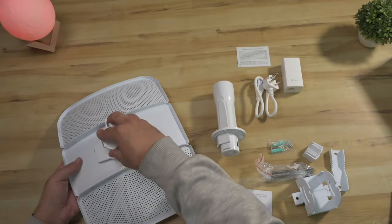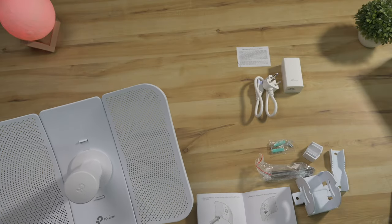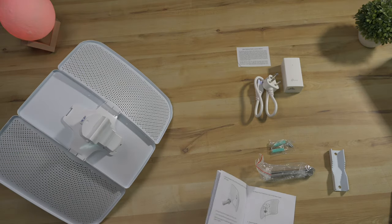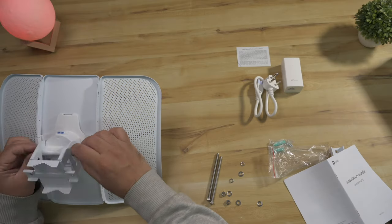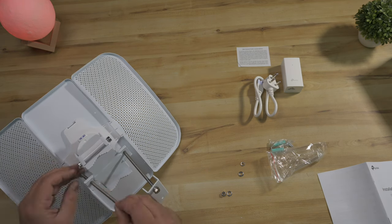This model for instance only has a 100 Mbps LAN port, which means that the internet speeds at the client side as well as to the access point from your router is capped at 100 Mbps. You will have to step up to the CPE-710 to get a Gigabit LAN port that will allow you to benefit from higher speeds if your broadband goes faster than 100 Mbps.